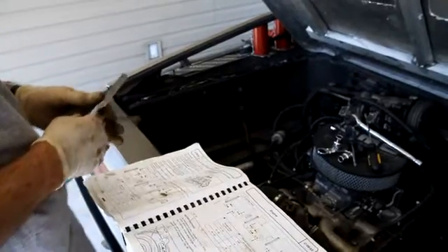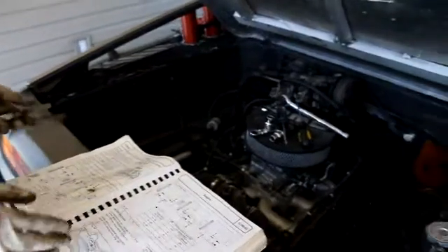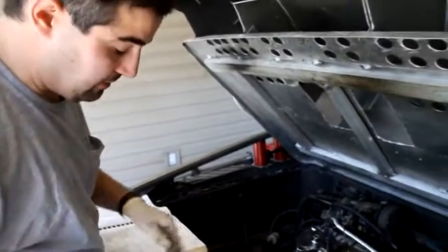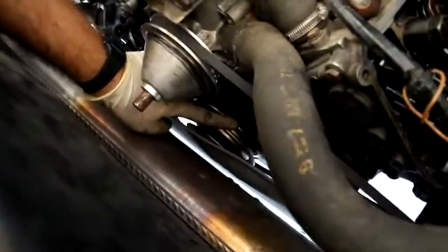Put the car into fifth gear with the ignition turned off, and we're going to push it to top dead center. Look on our pulley right here — there's a mark right there and there's a mark on the pulley. So we're going to put the vehicle in fifth gear and push it until that lines up.